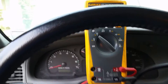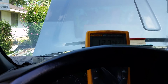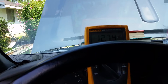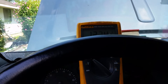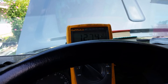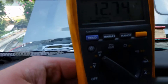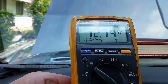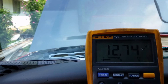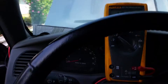I had another idea to show you a tip on using your new meters that comes in handy. You're going to be learning about battery load testers and how they operate, how to do a load test with the tester. Well, you can do the same type of test with your DVOM, and you can basically just hook it up to the battery, which is up here.